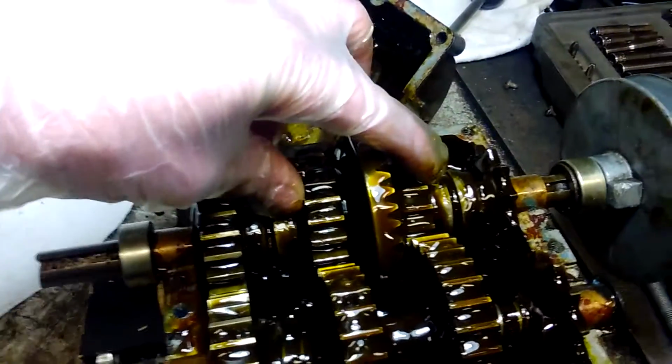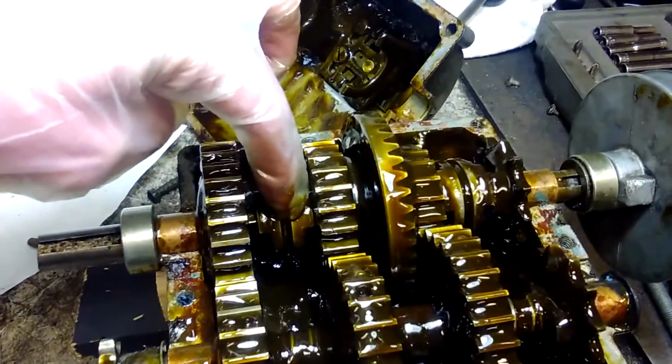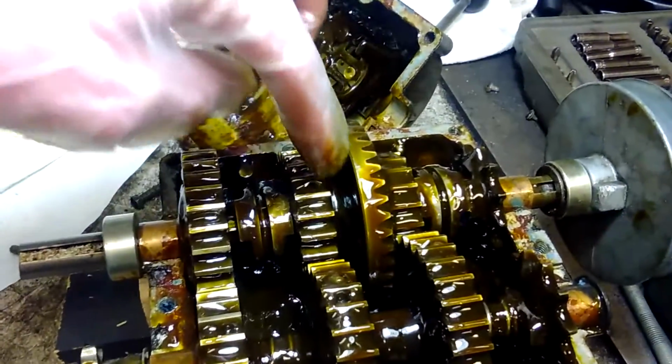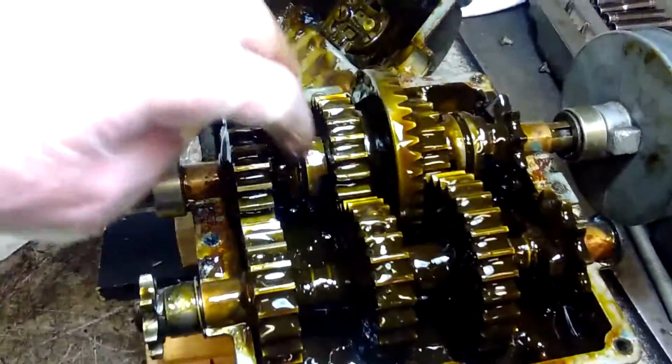You see that it kind of moves side to side there, because there's a lot of stress being put on the keys here. There's little keyways that these guys rock side to side on, and that's the only thing locating the middle from stopping it from doing this. So you can only imagine that the keys are wearing when it's not in that specific gear.